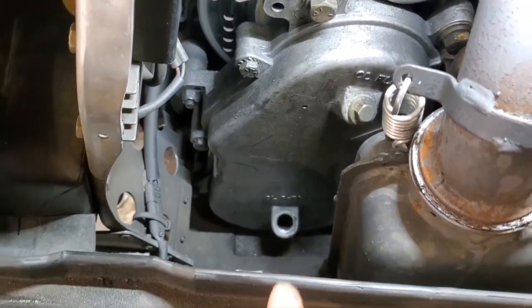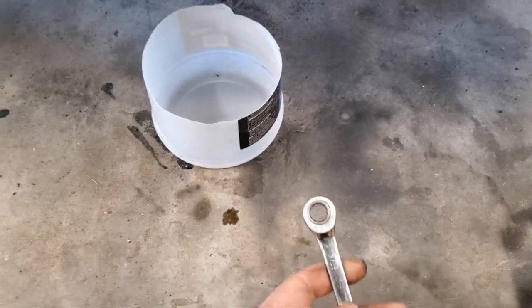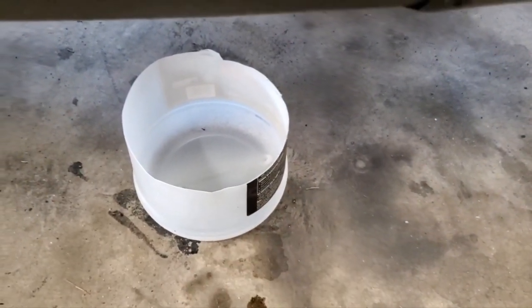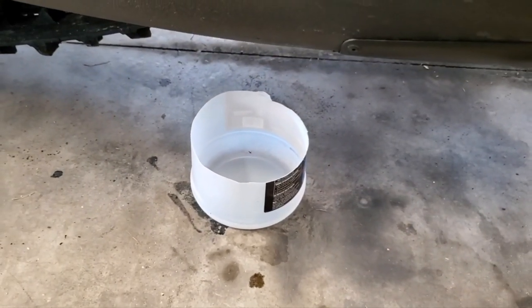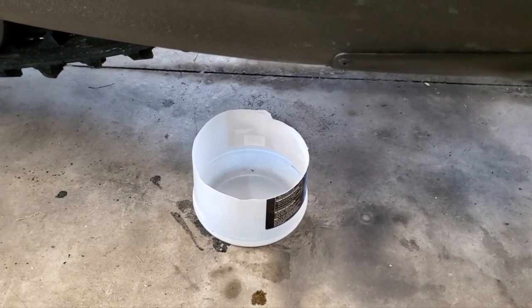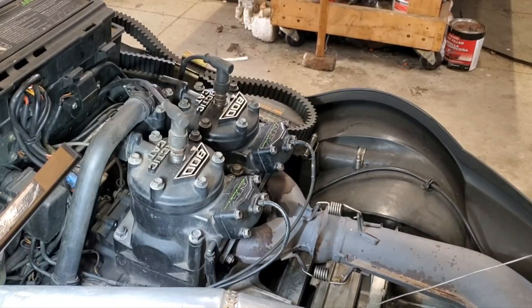And if you look right down there, underneath the sled, around the bottom of the tunnel there, you're going to feel a bolt. And that's going to be a 7/16. So I'm going to reach under there and loosen that bolt up, let it out, and let the chain case oil accumulate in that pan there. So I'm going to go ahead and do that off camera. You're not going to be able to see what I'm doing anyway. So I'm going to pop that baby loose and let her start draining. Then I'll get on to the step on the power valves there. So stay tuned.